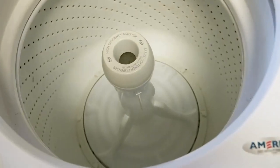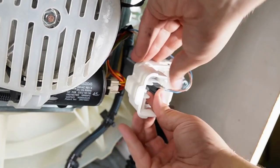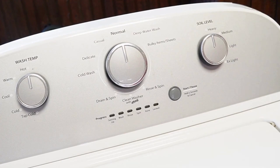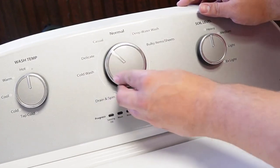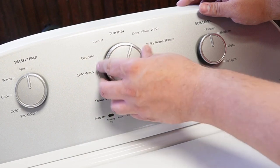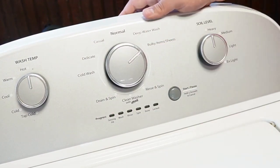This is the first type of reset, which should restore your washing machine to all default modes and settings. Now that we've done the first reset, let's go ahead and attempt to recalibrate this washing machine through the calibration mode. This is a must-do if you've installed any new parts on the washing machine, from a board to a balancing rod. With the washing machine freshly rebooted, rotate the dial counterclockwise 360 degrees, then turn the knob right three clicks, left once, then right once again.